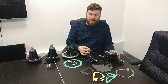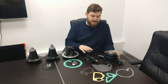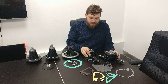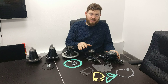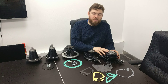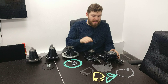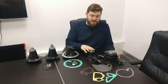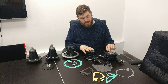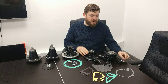The Mark VI starts off with the early one. The difference between this and this, as you can see, is this one has a pulley on. This one also has a pulley fitted to the flange, but the difference is this one has the pulley put on and then the flange is pressed onto the shaft and the pulley's screwed in from behind the shaft. So you can't actually remove the pulley without pulling off the flange. Then they revised it so the flange is pressed onto the shaft and the pulley is screwed onto the flange.